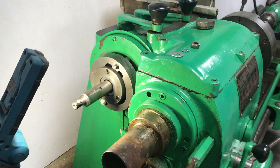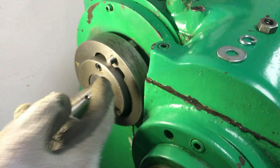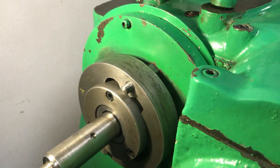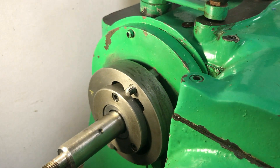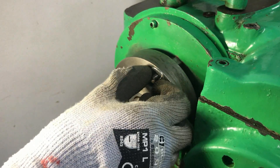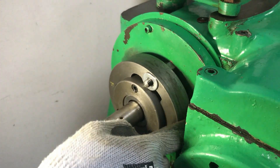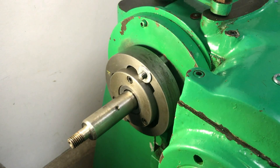The problem that we found during the week was that the nut on here had come loose, and the washer that was behind it, because the nut had come loose, had turned and was then taller than the brake face, and was then braking for no reason. So what we've done is got this new washer with a bigger diameter — we've filed off the bottom so that it's flat so that when it's on here it won't turn. And we've sanded down the top so that it's lower than the braking face. Then we've got a spring washer that we're also going to put on to stop the nut coming undone.